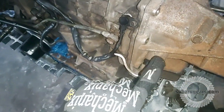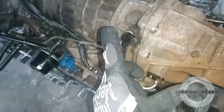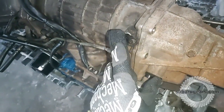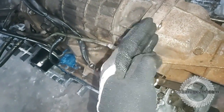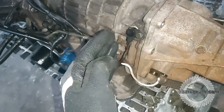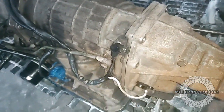I've removed the mounting bolt for the rear transmission speed sensor. This is the front transmission speed sensor. The computer looks at the differential between these two speeds to understand how much all-wheel drive is needed, and how to engage more or less clutch packs for front and rear wheel slip. So I've taken all those bolts out and we'll separate the transmission cover.